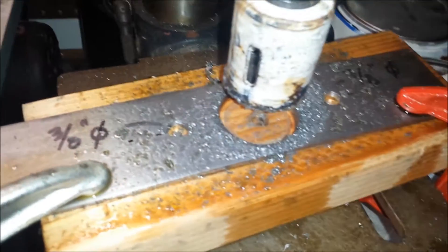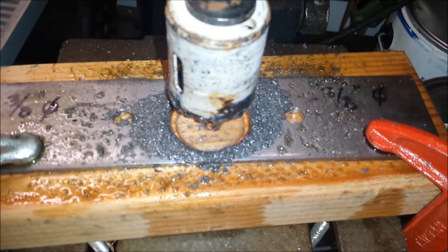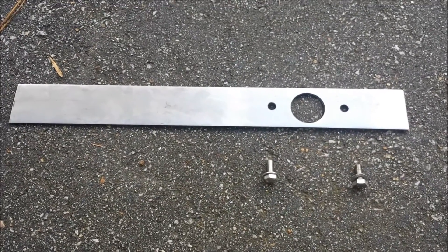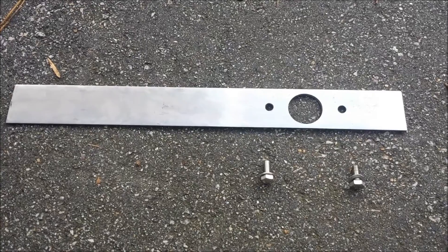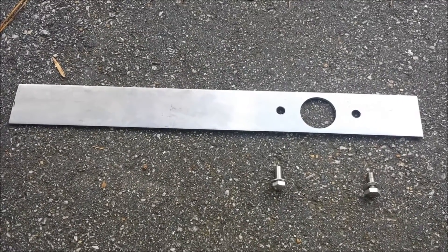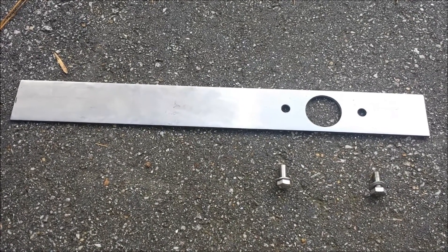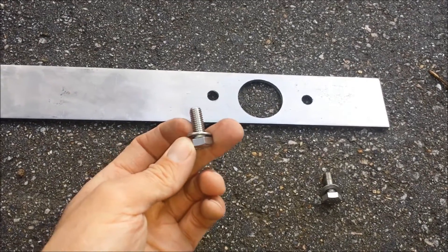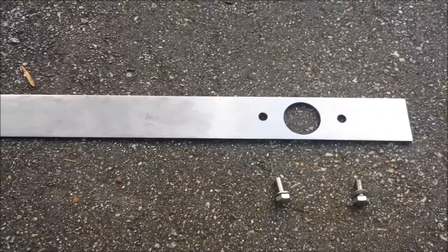I just finished drilling the holes on my drill press. I just need to get this cleaned up and take it to the vehicle and bolt it in place. The drill bits and hole saw actually cut really easily. I used PB Blaster as a lubricant since I didn't have any cutting oil — it did the trick. I just had to go pretty slowly with the hole saw so it didn't bind up, but it only took a few minutes and gave me a nice clean hole. I've got the M8 by 1.25 bolts with a washer around each one and I'm ready to go. Let's get this in position and get it bolted in.